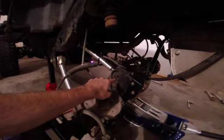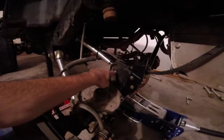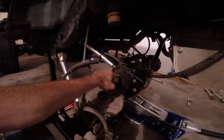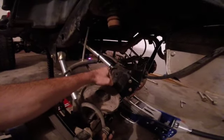The lower control arms, when you're torquing them, they use a 7/8 bolt and a 13/16 nut. And then also, the bolts provided for the upper control arms are really slightly too big. And I messed mine up getting it through this tiny hole. So either drill it out, or I totally messed up the bolt and I'm just going to end up putting a stock bolt back through here. It was so messed up on the other side I couldn't thread the nut on.